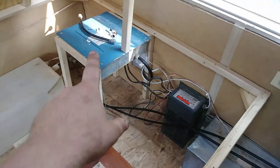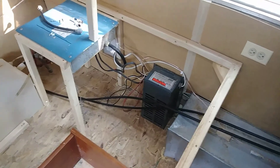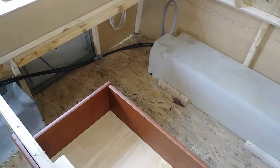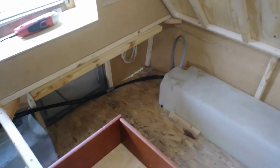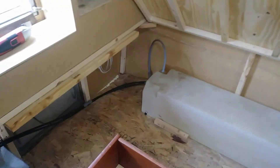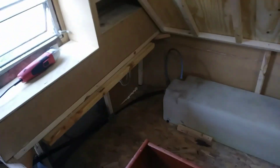Got the fuse panel hung up there, got the power inverter put in its place. I still gotta clean up the wiring — it's a bit ugly. But everything's running. Got the water tank put back in and started routing the plumbing for the water. The water heater — I'm getting an electric instant-hot water heater that's gonna go back here. I gotta go pick that up yet, but you know, money — I'm trying to do this on a budget.